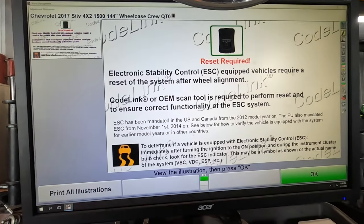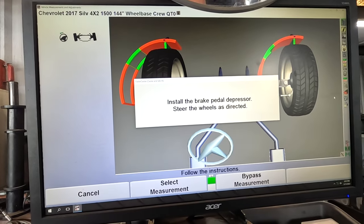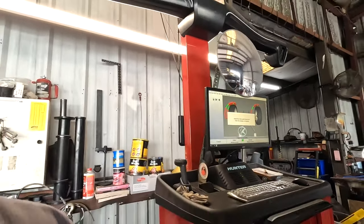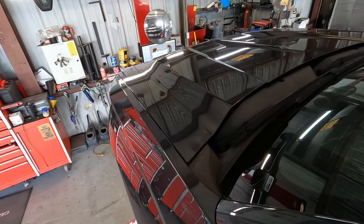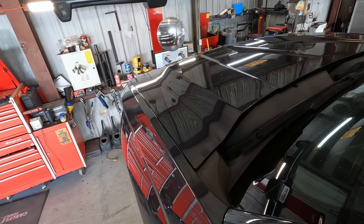Hopefully there aren't redundant ones — I doubt they'd be redundant suspension packages. If any of them match, that's what you have. So I've got to lock the steering, lock the brake pedal, and do the caster swing. Brakes are locked. Can't see the caster so I've got to stand on the rocker to do it. Luckily it doesn't matter if you block the rear heads for the caster swing.